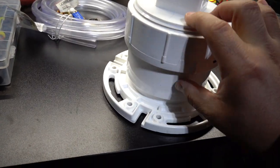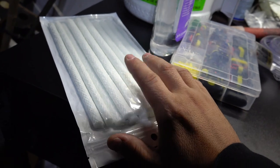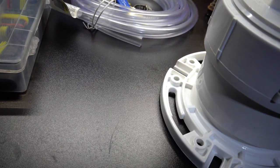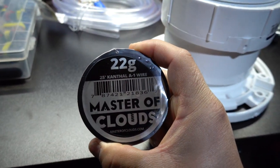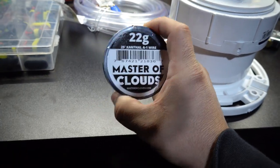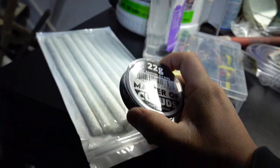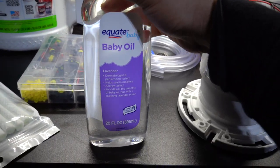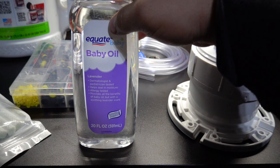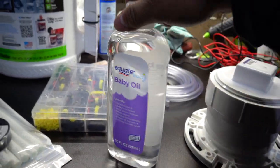Now inside here, in order to make smoke, you need some torch wicks. These are for those little tiki candles, and you need to wrap some of this wire around it. The best wire to use is this Kanthal wire. I will have links to all of these things in the description below. So you wrap this around the wicks, and then you spray either some mineral oil or baby oil on it. Basically the main ingredient in this is mineral oil, so you can always use baby oil.